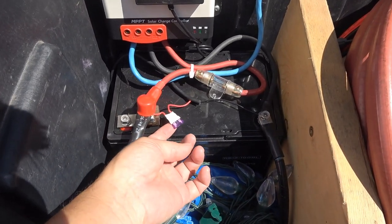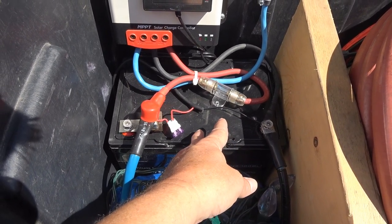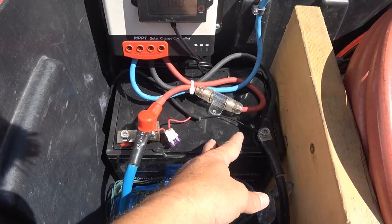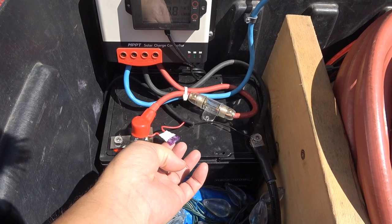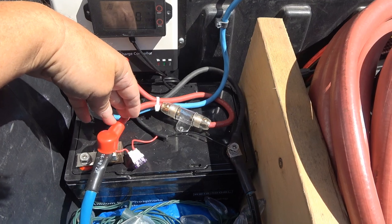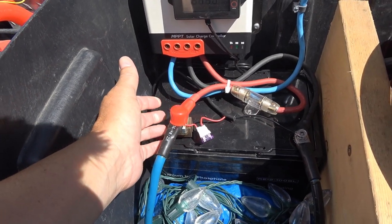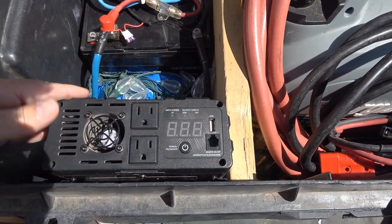You can see this little fuse here — that's a wire going back through into my truck cab, running along under the floors and popping up, attached to the wires that keep the parking monitor for my dash cams going. I've put a 3 amp fuse in there to protect that wire in case of a short. Over here I put a 40 amp fuse to protect the solar controller wiring, and I also have a terminal block fuse underneath — right now it's 200 amp, but I've ordered a 125 amp fuse for that, because it's powering my 1000 watt inverter that I've mounted up here.